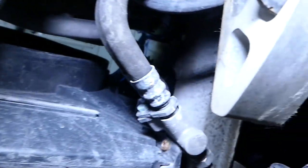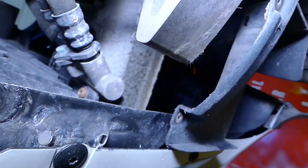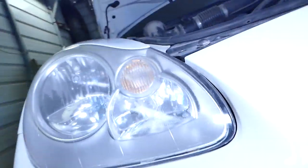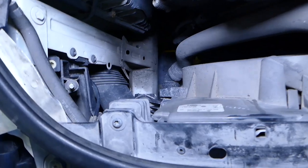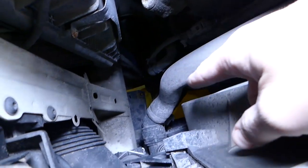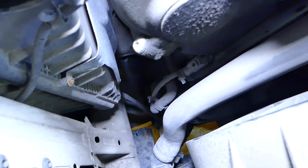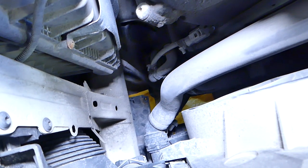Underneath you can see the radiator — next to the transmission lines you'll have a green or blue drain plug. Ours doesn't have one, just an aluminum radiator, so we'll drain through the lower hose. The bleeding procedure afterward is quite complicated so double-check the channel video. There is a metal spring clip on the lower hose — pull it straight up with a screwdriver, then move the hose out. Have a container ready to catch all the coolant, and use new coolant since this one will be contaminated.